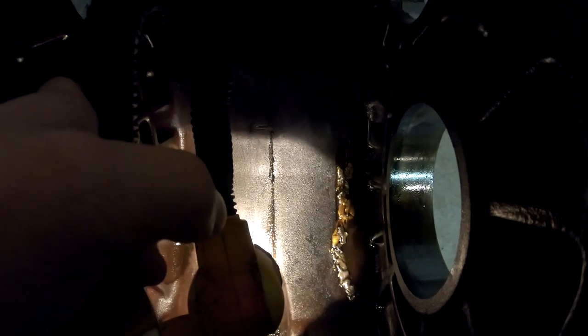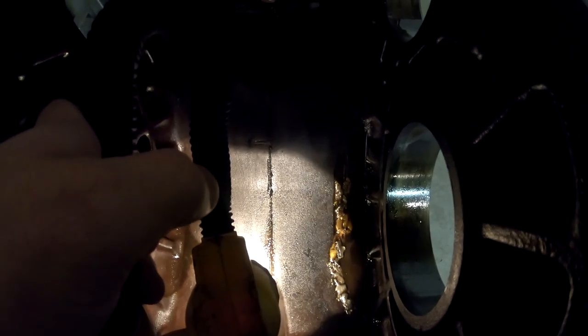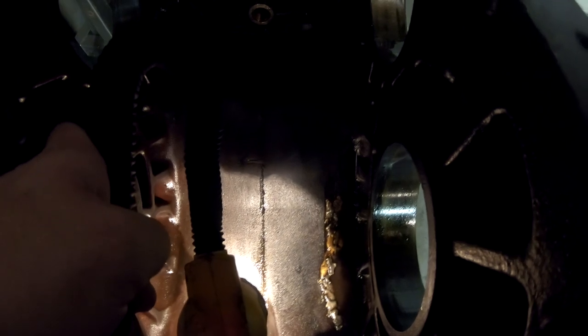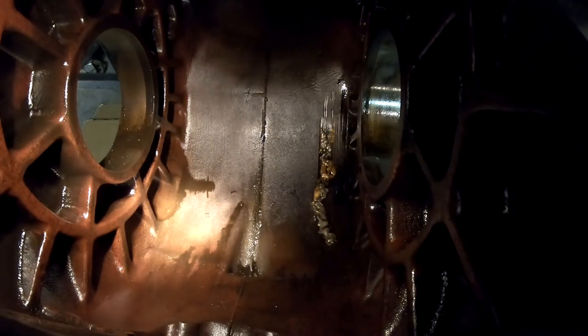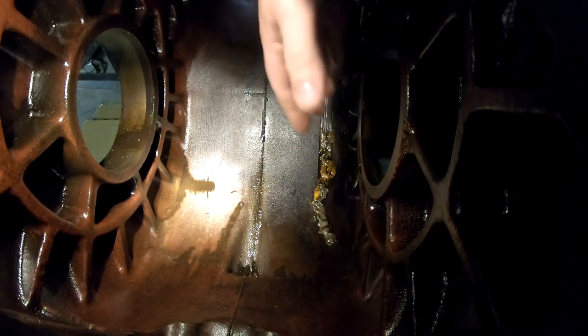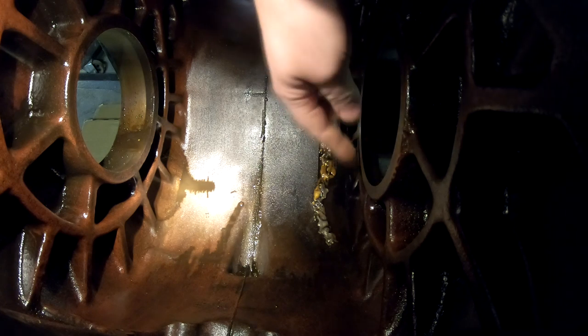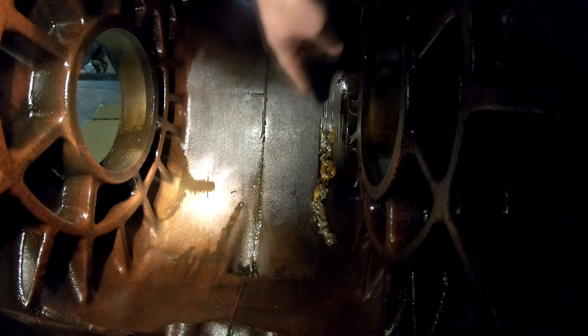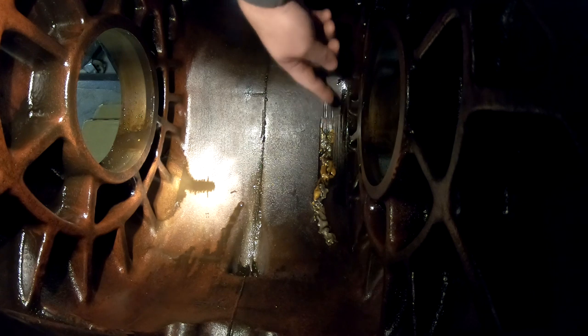If you see that big goober line on the right side of the screen there, that is a weld, and a pretty nasty braze slash nickel rod weld. What happens on these H's and M's is this inner bearing here fails over time, and then the rollers in that bearing drop down inside the case. When that happens, they get underneath these bull gears and sandwich themselves in here